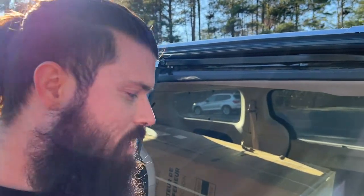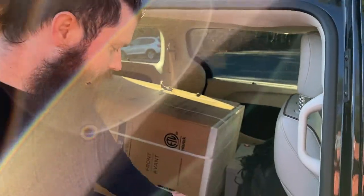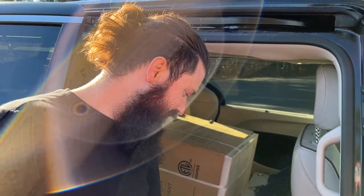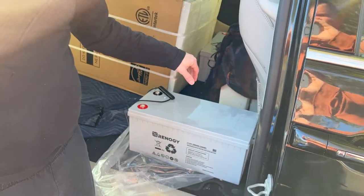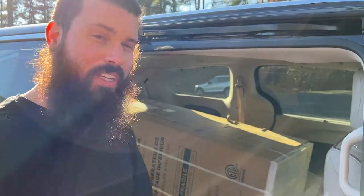We're at the car now, about to get our new batteries and fridge on board. This is just one of two AGM batteries — they are huge and very heavy, just one is about 130 pounds. We decided to go with AGM compared to flooded, which is on the cheaper end. These are more expensive but they're sealed batteries, so there's no caps where you have to fill with distilled water. Maintenance free, and you can mount them on their sides.